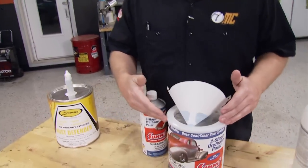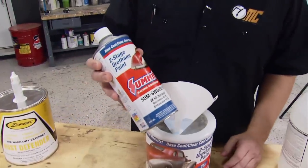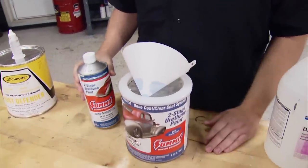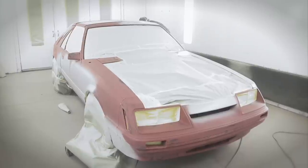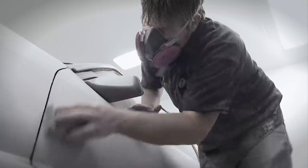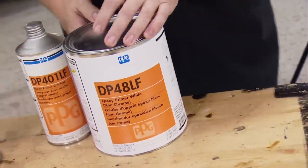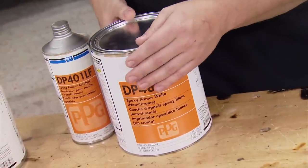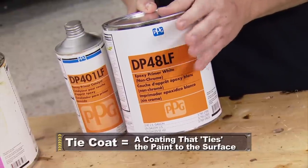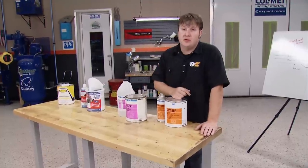Here's why urethane is so popular — this stuff is water resistant, which means if you've got a project that's got to hang out for a bit, that can go a long ways. Also, it's activated with a hardener, which makes it a lot tougher than a primer that can just simply dry. We used this Summit urethane primer on Project Dark Horse, our Fox Body Mustang. Urethane is also a medium build primer, and the Mustang really didn't have any big cosmetic defects to speak of. After the initial body work, a coat of primer, a little bit of sanding, and then another coat, and it was ready for paint. Right here we have epoxy primer — urethane is often considered a type of epoxy. Typical epoxy primers are geared mostly toward being a tie coat. But be careful if you're planning on putting this stuff over top of an acid-based primer, because acid can interfere with the curing process.